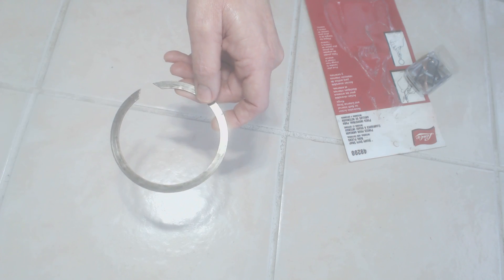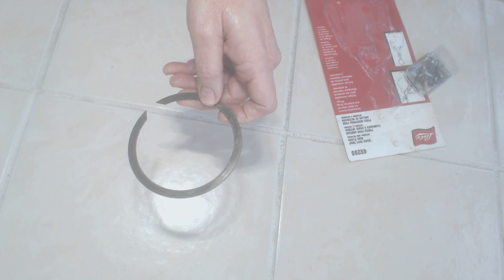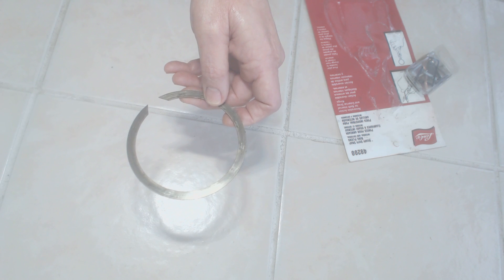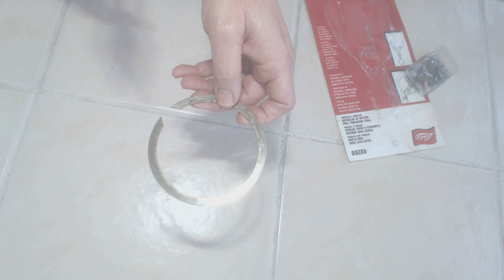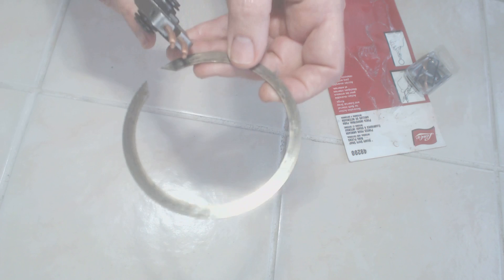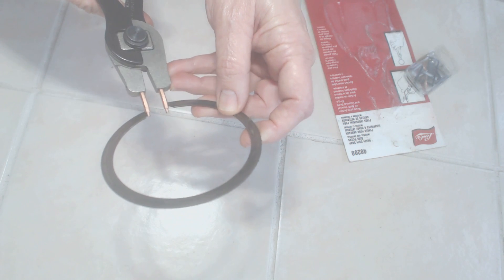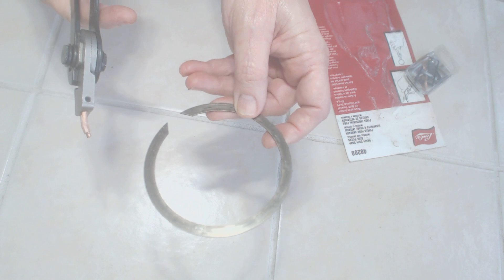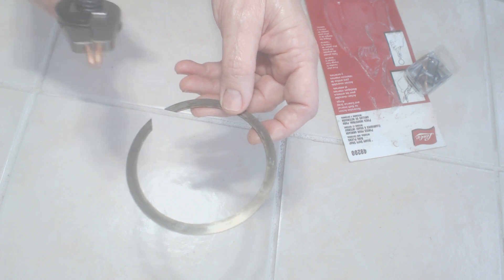If you've been through the transmission bench videos you may not recognize this snap ring — it's the one off the reverse drum. They tell you to never reuse it; it's replaced with the spiral retainer. You'll notice that if your snap ring pliers have rounded tips you can probably get it off, but you're never going to be able to get it back on. They have a solution for that and I'm going to take a look at that right now.